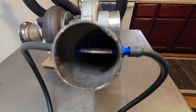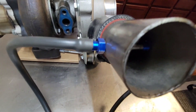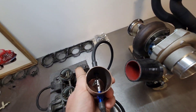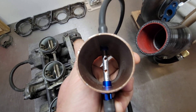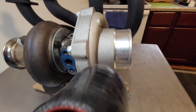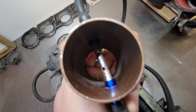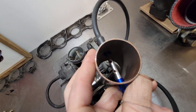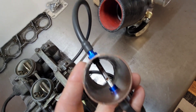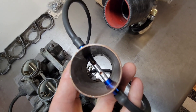So essentially, that's just a quarter-inch tube that's inside of this tube. It's got a couple of fittings. See the holes in that tube? Those are the boost reference holes — they reference the boost from the turbocharger. The boost comes out of here, will go straight into here, and those two tubes will see the amount of boost that it makes. It goes to each side — that's why there are two holes. It splits it off equally and balances it in the middle because of the pitot magic.